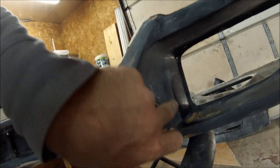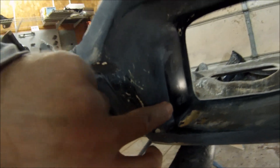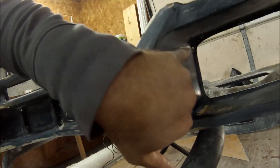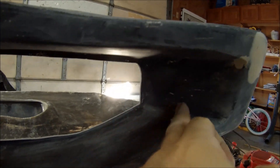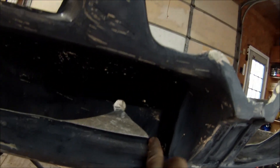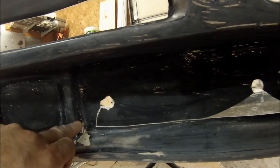Stay about a quarter inch from this lip. Don't feel bad if you get your boards and they're hitting the dash — all you have to do is cut it back, trim it back, make a straight line to where the boards sit. You can cut it back over here a good two inches, maybe even two and a half inches on this side as well. And in here you've got a good probably inch and three quarters to cut it back up to this line, and over here about an inch.